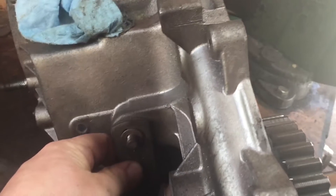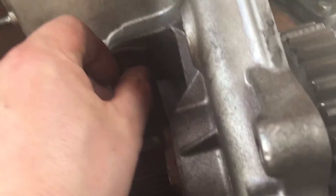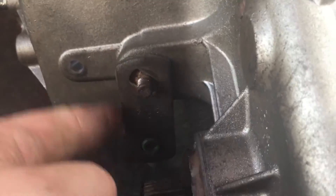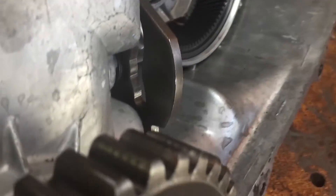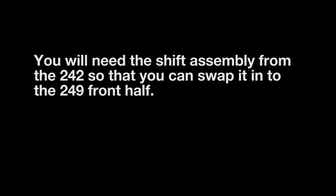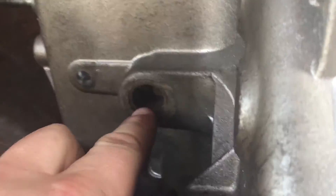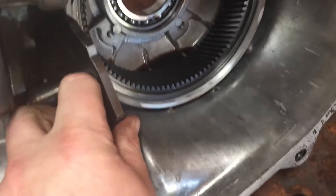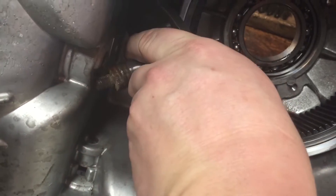I'm about to remove my shift lever — I just used an impact and a 14mm. I took that off, so you've got a nut and washer. I'm looking at this because this line is straight up and down, and the shift pattern is also kind of straight up and down — that's how I'm judging it. I took a brass punch and kind of tapped on it to get it through. Some people would say put the nut on it first — that's fine too. Then once you're in there, you just rock it back and forth a little bit.